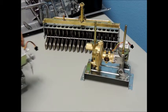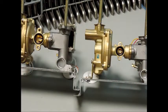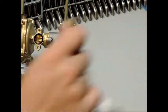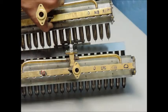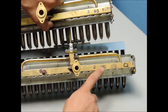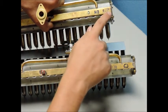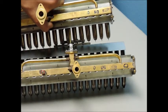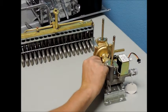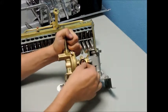Please note that the opening on the port on top of the water valve where the burner assembly connects is larger for the natural gas sub-assembly and smaller on the propane sub-assembly. The burner assemblies will have a stamp on the bottom identifying which fuel type should be used — LPG and 0.69 for liquid propane, and NG and 1.1 for natural gas. Please don't lose the small rubber O-ring that supplies the seal between the burner assembly and the water valve assembly.